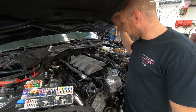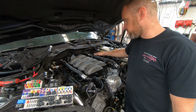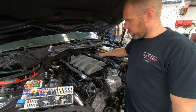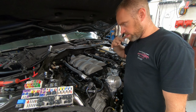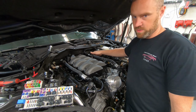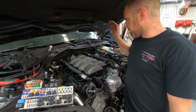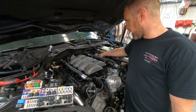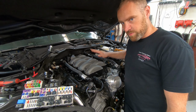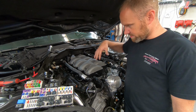So when it comes to fuel systems, I have a -10 feeding up here to a -8 conversion fitting. Now, the -8 is the feed line size recommended from On3. So I have a -10 in between where it's impossible to replace the line, just in case he needs to upgrade later. And because of that, right here I have the converter, and then I have the -8 coming up so that it's On3 spec up to that point, or from here on into the engine bay.